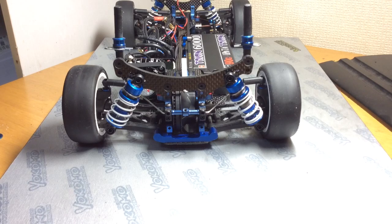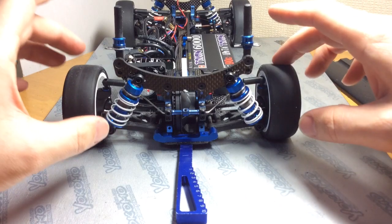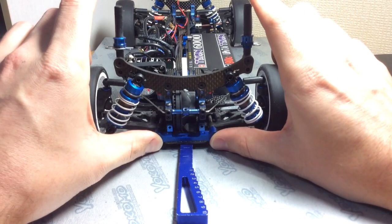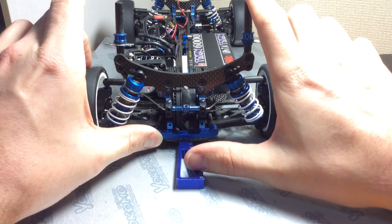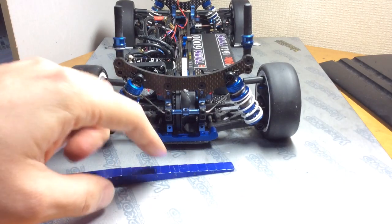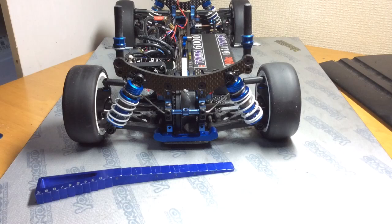So right now the chassis is sitting in front of us. We're going to do droop override height. Our ride height is set at 5.5 millimeters. What we'll do is take our fingers and put our thumbs right where the block is and just pop up the suspension like so. Then while the suspension is popped up, we'll take our thumb and slide the gauge underneath. We do the calculation: starting at 5.5, so 6.5 is 1 millimeter, 7.5 is 2 millimeters, and we're probably around 8 millimeters — so that's 2.5 millimeters of droop. This is a quick and effective way of doing it.